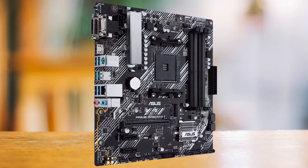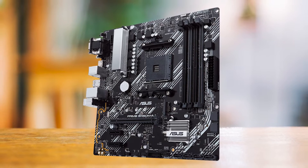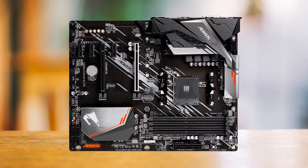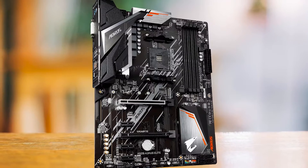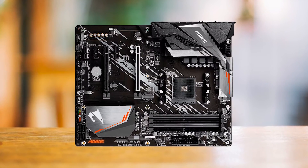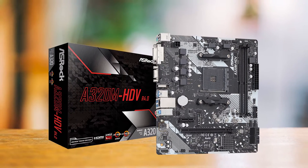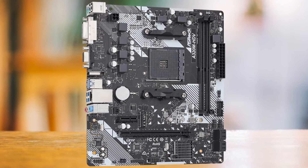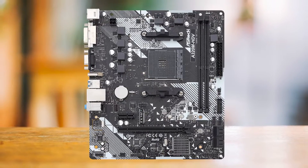Since this is a lower-end board, it's important to look into all the alternatives before deciding, especially on a really tight budget. The CPU itself costs $100 and this board is widely available for around $80. Compared to lower-priced boards, it has significant advantages over A320 and A520 motherboards, including the ability to overclock, out-of-the-box support for almost all AM4 CPUs, and four RAM slots. Going with an A320 or A520 motherboard doesn't save any significant money either — almost all budget A320, A520, and B450 boards are between $50 and $100. The cheapest AM4 option right now is the ASRock A320M-HDV R4.0 at $61, but that board only supports 32GB RAM and has much weaker VRMs, making future upgrades almost impossible.